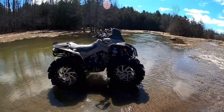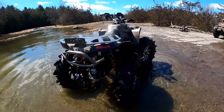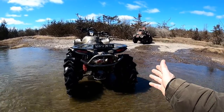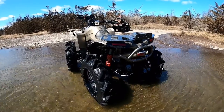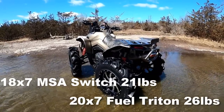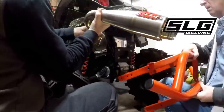Havocs are one of my favorite tires in 34 — they're lightweight, a little bit softer compound, and the 18-inch wheel gives me more sidewall which made a hell of a difference in ride quality. We went back to the MSA wheels, which have a more favorable offset at zero versus the plus-10 of the Fuel wheels, kicking the wheels out a bit more and doing away with spacers. The MSAs are also a couple pounds lighter than the Fuels, and the Havocs work great.